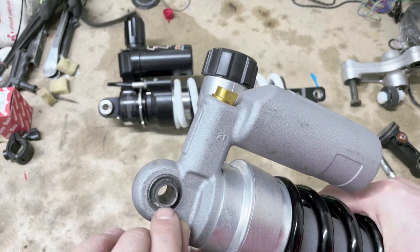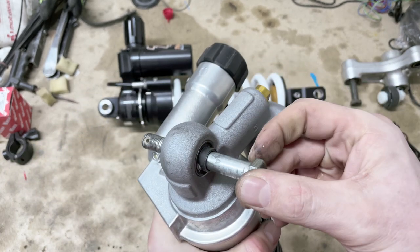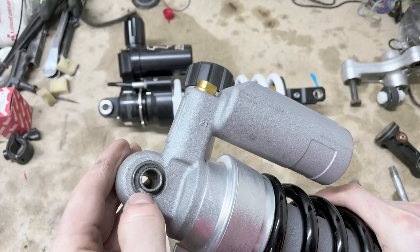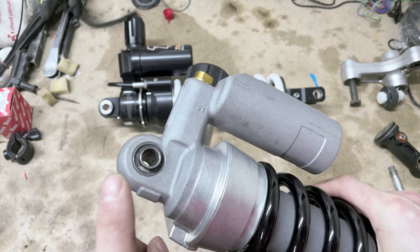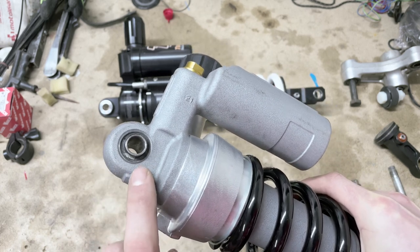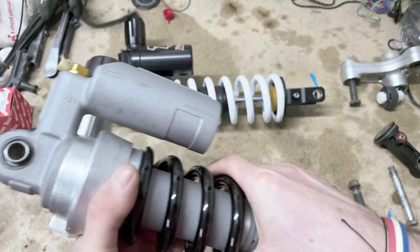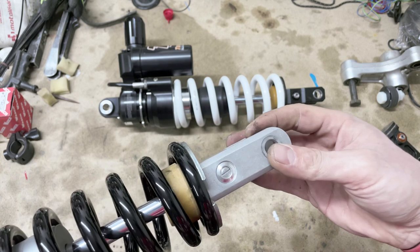Some parts, though, are really not in the catalog — and one of those is this top mounting point bushing. There's a rubber bushing which is pressed in, and what happens is: you have the bolt through it and there should be no play. As you ride, I destroyed that in 40,000 kilometers — the rubber wears out and then it's gone and you have to replace it. That was really difficult to get; it ended up coming in the mail from Lithuania.